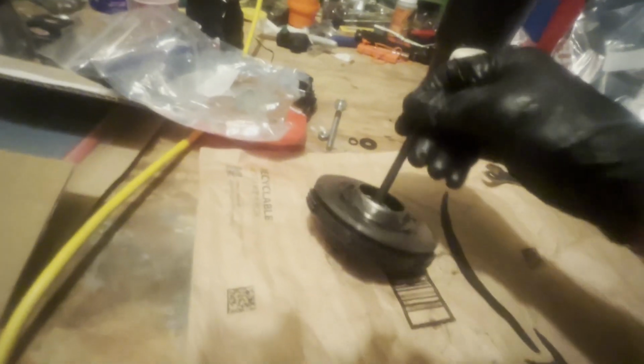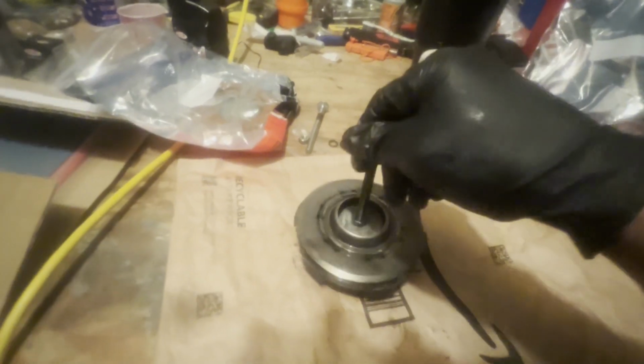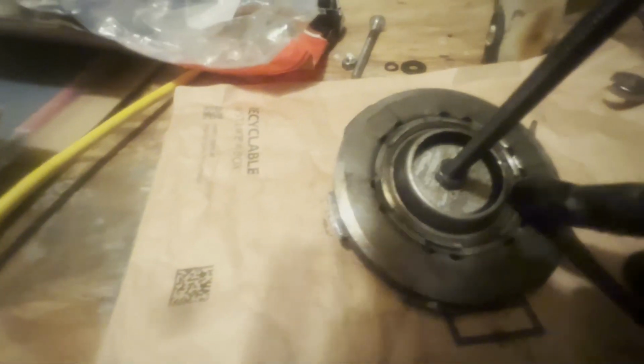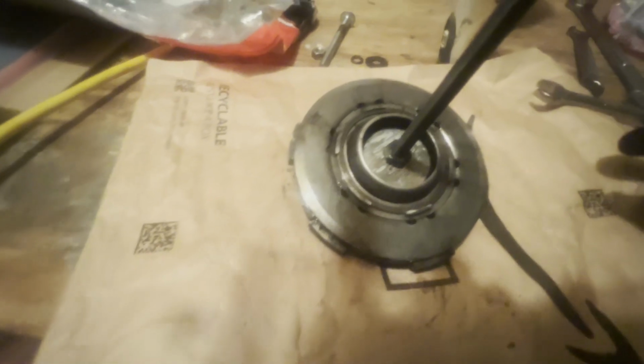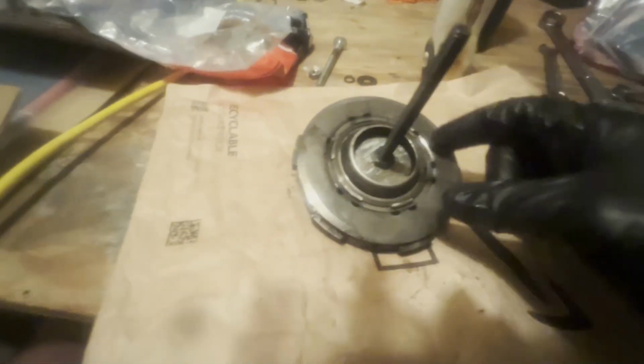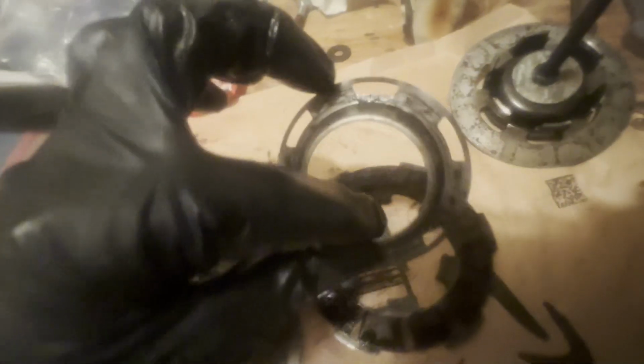That worked out. Now you can see there's some slack here. The plates are compressed, and so now I can release the tension spring clip here. There's a little gap right there. So I'm going to get a small flat screwdriver and carefully pry that out and around. As you can see, I released the spring. This centerpiece then pops out, and then this top plate releases. I did have to turn this upside down and bang it like this, and things eventually came out.